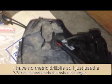This is the cover. It actually goes like this. That goes on the headlight, and so it protects the light, as you can see. So I'm going to need to drill a hole right where that dot is probably, so I can run the cables through and use the grommet. All right, more soon. So as you can see, I drilled the hole to run the wires through, so now it's all nice and clean. The grommet they include is nice. It's a 23 millimeter hole, which I don't have in drills, so I used a 7/8 and just drilled a little big. So I got everything connected.